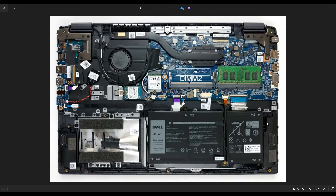Moving on to the speakers — you get a speaker on this side and a speaker on this side. They're connected by a cable that runs down under the caddy and under the battery. Midway through, they break off and plug into the motherboard here under the Wi-Fi card — that's where you would access the speaker plug. I'll have some speaker replacement options below in the description in that link.